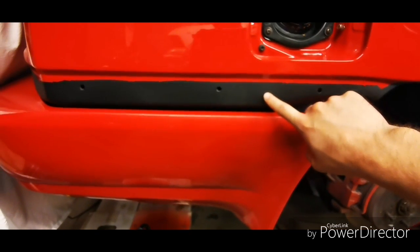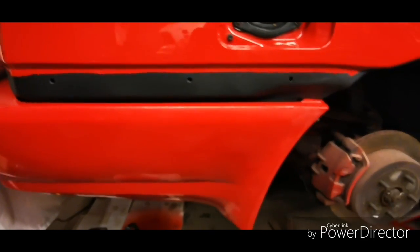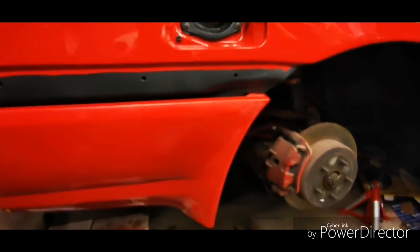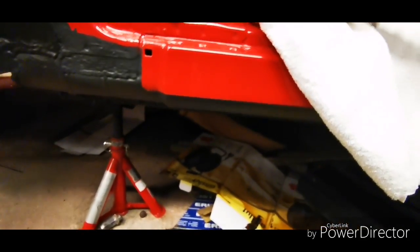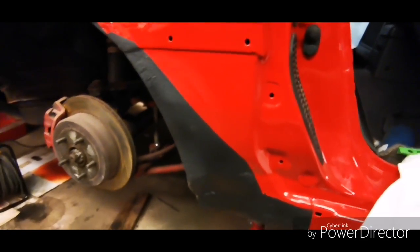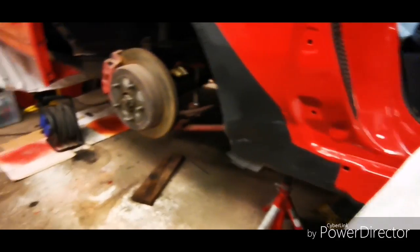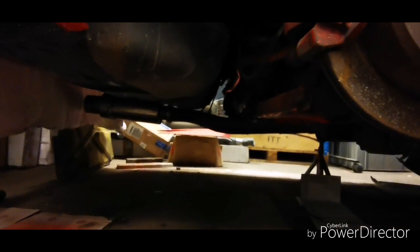I've also used Valvoline body paint — this stone chip paint. I already had it in the wheel houses but I added some extra just to cover up the overspray from the painting. I also added it on the sides of the car and behind some plastic parts.